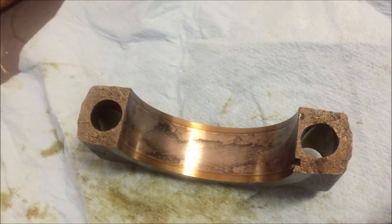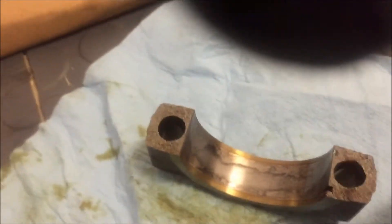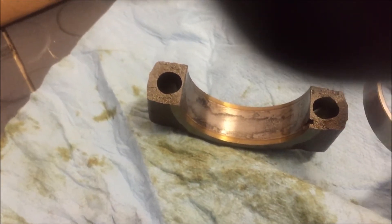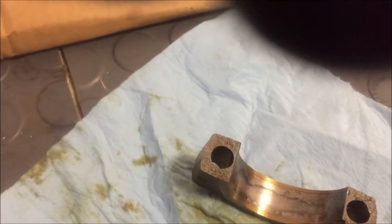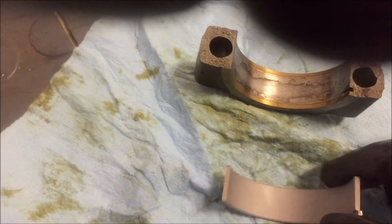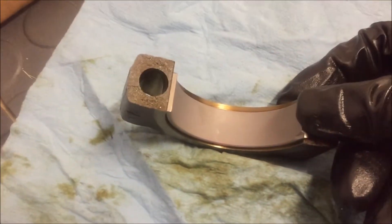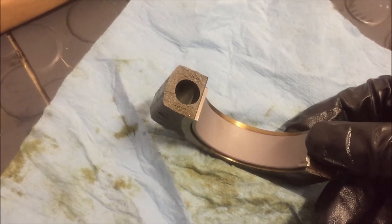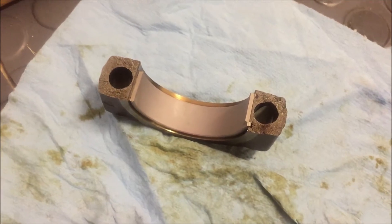Here's one of the caps of the rod bearings. I'll show you how to put the rod bearing on. This is a cap — it's going to be the red side. Remember: red cap, three letters. So basically you put the little indentation where it is and just push down — I can use two hands for this — and it should just stick like that. I'm going to put some grease on top of it and install this bearing.